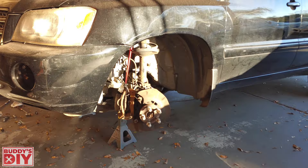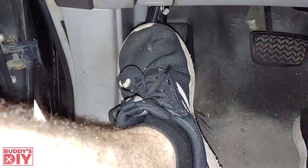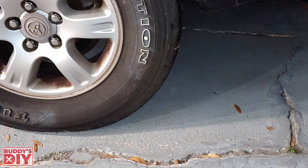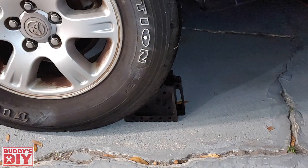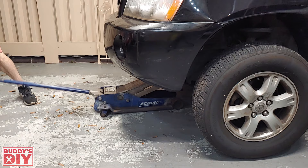Let's pull the old brake rotors off the vehicle so we can get to painting. We've got to get the front of the car off the ground to remove the wheel and access the brake rotor, but we need to do two things first: engage the emergency brake and apply wheel chocks to the back wheels. If you don't have wheel chocks, you can use a 2x4 wedged in there. With those in place, we can start jacking up the front of the vehicle.